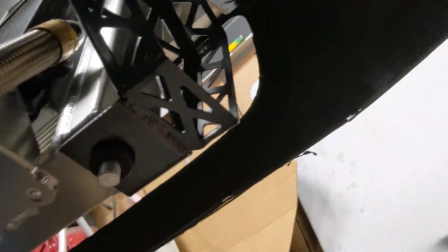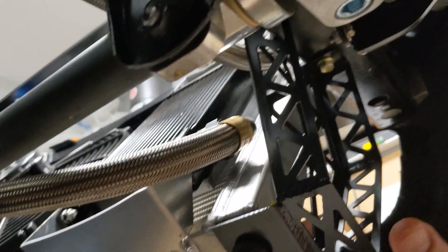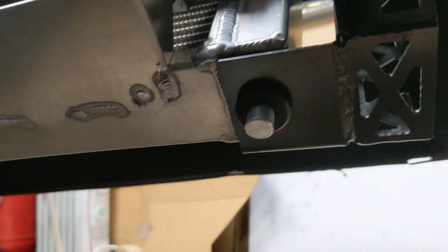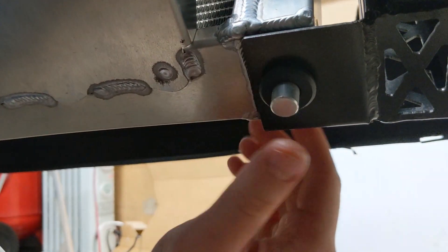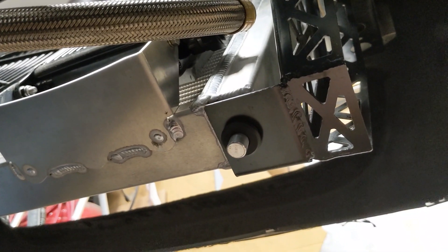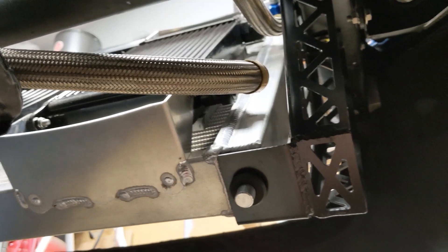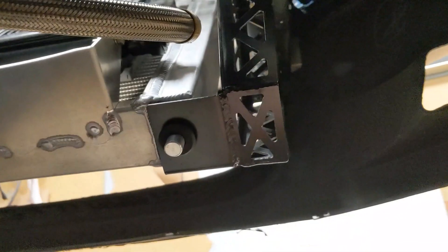While we're down here, here's how I designed these brackets for the radiator — super lightweight, and I did FEA on these. It's kind of a saddle design, controlled by pins on the radiator. When you mount your radiator, you want everything touching it to basically be rubber, because aluminum cracks fairly easily. That's exactly how all the OEM stuff is as well.